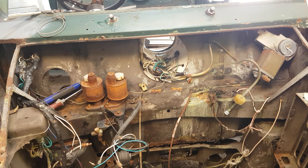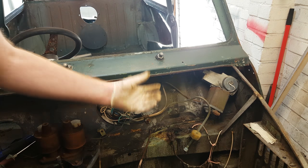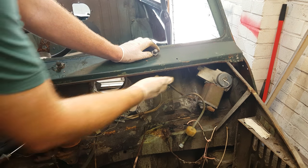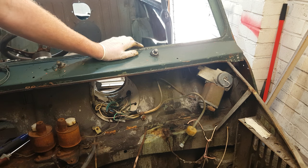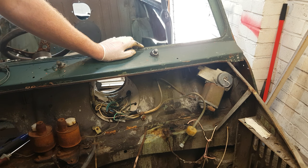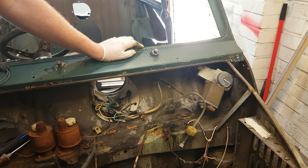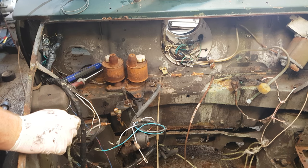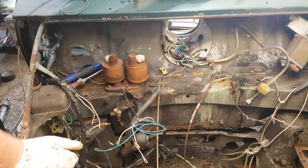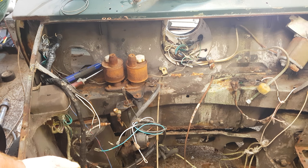Just pausing for a minute as always. Trying to get the wiper motor off — the nut was spinning, and also the housing for the little gear bit on the back was turning. I don't know if I can grip onto it, so what I'm going to do is gently use an angle grinder and cut the side of the nut off, hopefully not damaging the threads too much. You sacrifice a nut but hopefully save the other bit. I'm also thinking about making the bar for the rollover so it can fit with the master cylinders in place, in case I ever need to mount the car on the spit again. Crack on!